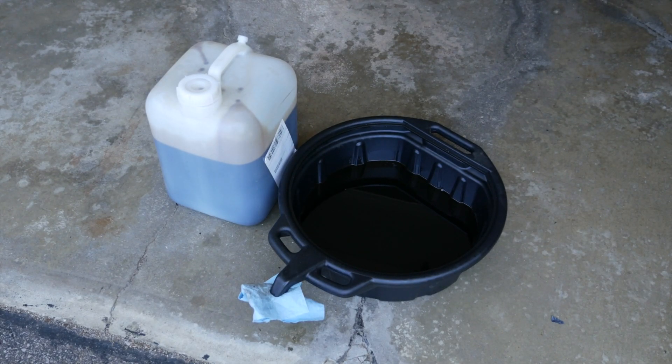After changing your fluid, always make sure to recycle the old oil or fluids — you can take these to AutoZone or any other auto parts store. And be sure to clean up any messes on the floor. I just got back from taking the Corolla for a test drive, and immediately I can tell it shifts smoother and goes into gear easier. Overall, for about 30 to 40 bucks spent on the Redline, it's definitely worth the upgrade so far. Also, after the test drive, make sure there are no leaks on the drain and fill plugs — those seals need to be nice and tight. Thanks for watching — let me know if it helped or if you have any tips on anything I could improve.